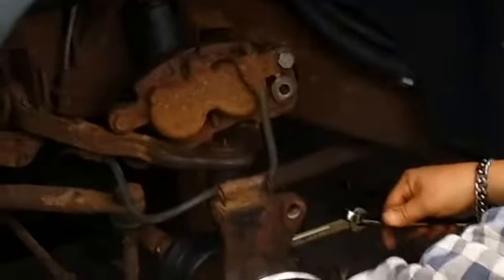I pinched the wire — I hope I didn't break it. Be careful that you do not pinch your ABS sensor wire in between things when you're putting the hub in. I almost made a bad mistake. Lesson learned. I'm focusing on making this video and not paying as much attention to what I should be doing.